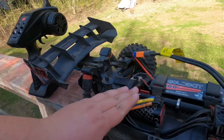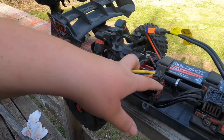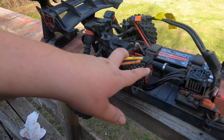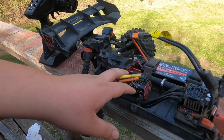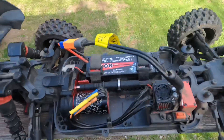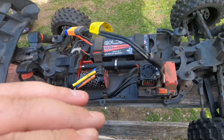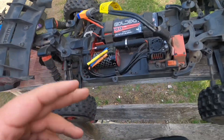I just wanted to share with you guys: when you get this model, the first thing you should do is take the motor out, pull it apart, and pull out your bearings — otherwise you're going to be waiting for a warranty motor. Make sure you change all your motor bearings right away when you get this buggy. It's going to help tremendously.